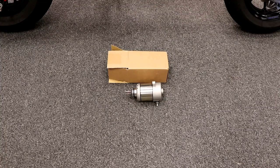It works just fine. And obviously up until this point, for all you guys with big bore kits, you've been using the stock starter as well, and it works. It's not the best. We all have gotten to that point where you hit the starter button and it goes, and then you wait a second and you hit it again and it finally turns it over. Small solution to this is getting the anti-gravity or another similar type lithium battery for a little bit more cold cranking amps. That does help.